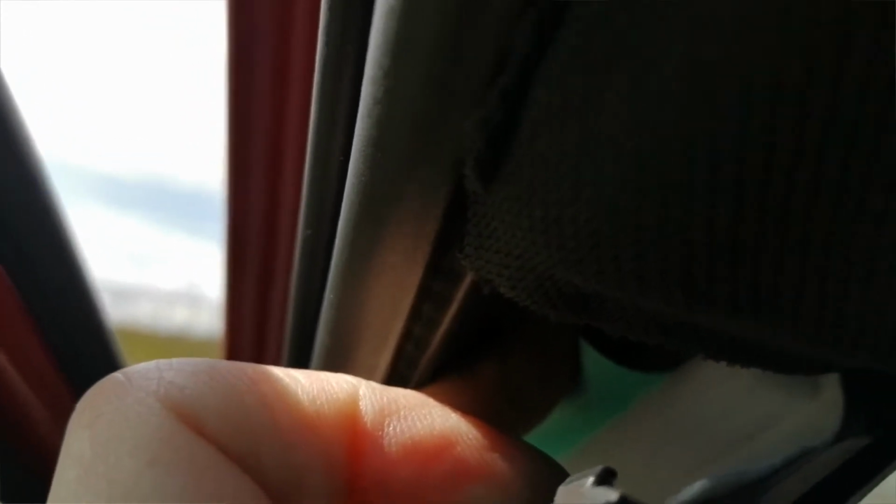and then there's an airbag behind this plastic. So what we're going to do is get our fingers again, flex that out of the way. Can we show you the airbag? There we go. You put your finger behind the airbag, look, there you go. Put your cable behind the airbag and run it down the trim panel here, all the way to the edge of the dashboard.